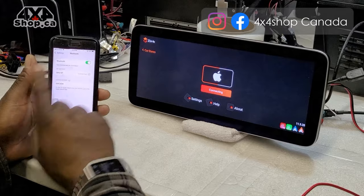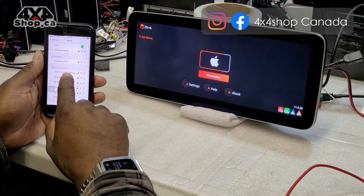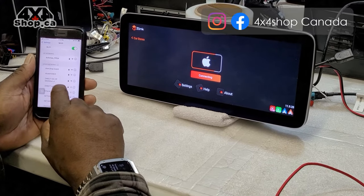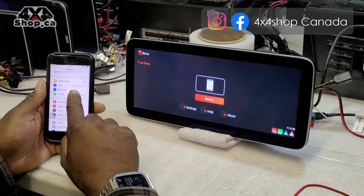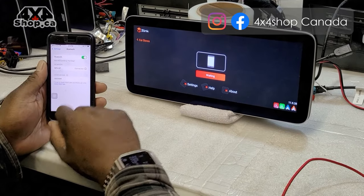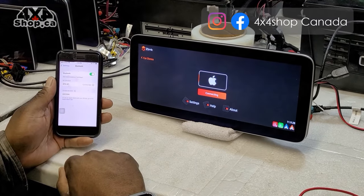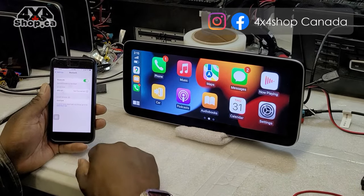For troubleshooting, double-check back and see what your Wi-Fi is connected to. Forget your home network for the time being and allow the system to connect itself with the Android system. Also, close all your open applications as they could be interfering with your connection. Select 'Use CarPlay' and it will connect. What I did was delete my Wi-Fi network because that was interfering with the CarPlay signal, since CarPlay works through both Bluetooth and Wi-Fi.